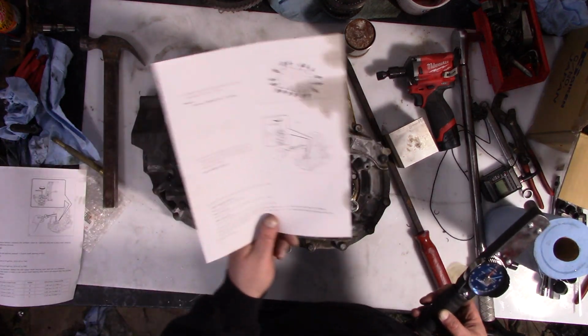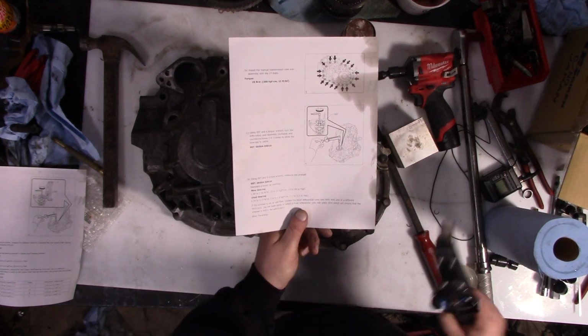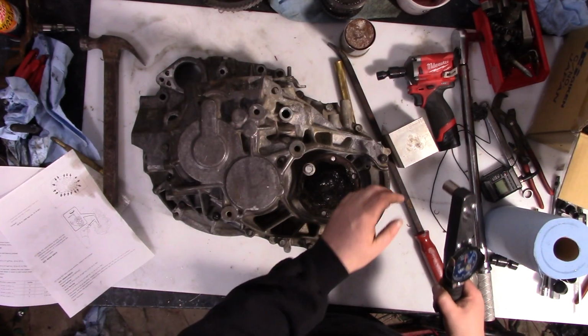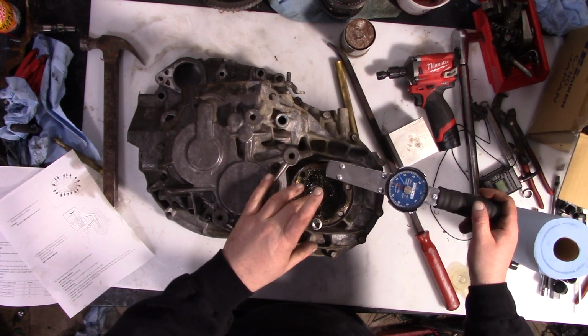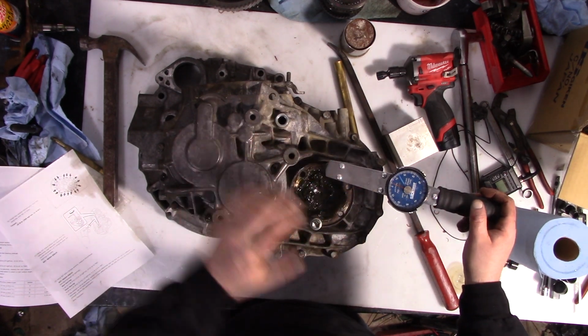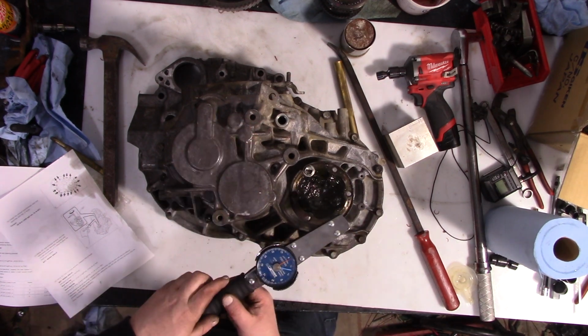There you go. That was 15 to 20, give or take, which, for new bearings, is right in our range. Range is 13 to 20. And yes, being out here does technically make a small difference because it's the distance between the pivot and where it's being measured, but at a 90-degree angle, it's close enough. So yeah, I'm pretty happy with that.